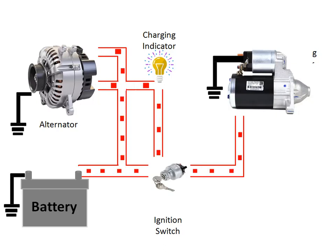If the alternator voltage is too high, it forces excessive current flow through the electrical components, accessories, and the battery, resulting in damaged electrical components and excessive battery gassing. When the alternator voltage is too low, it does not supply enough current to the electrical accessories and the battery, which may lead to improper operation of some electrical components or accessories and a undercharged battery.